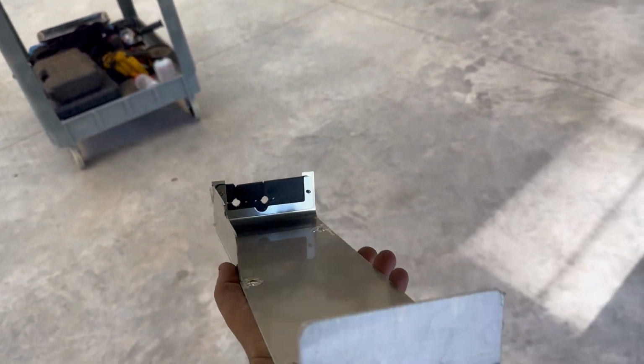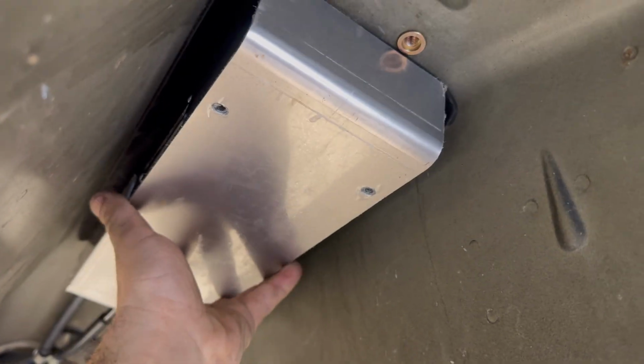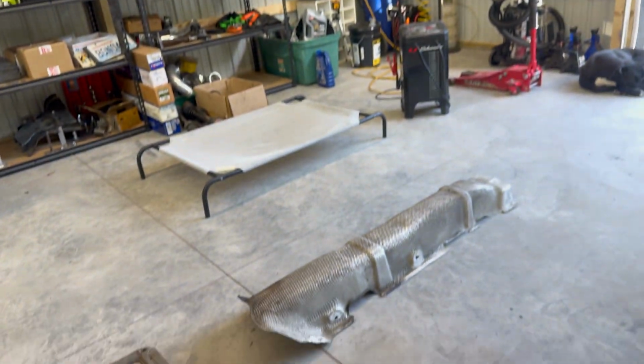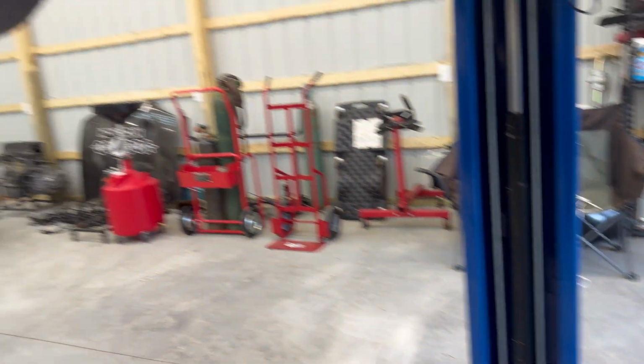Once that's all done, you'll grab the bottom cover plate, you'll hook it up onto the shifter cables, and then this will go back in place, put the 4 bolts, and then you just reverse the steps, installing all the OEM components, and that's about it.